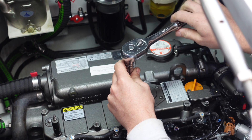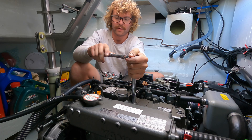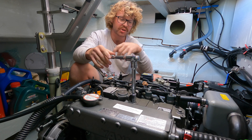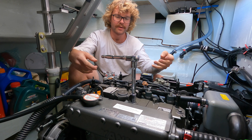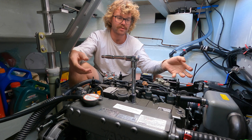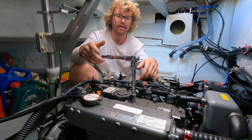When you do this, make sure the motor is cold. The workshop manual does say to do it cold. If your motor is warm or hot, everything's expanded and your tolerances have changed. So if you adjust it when it's warm, it's not going to be within factory specs when it's cold.